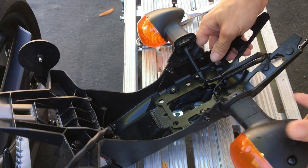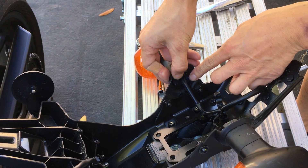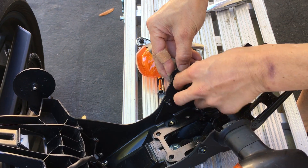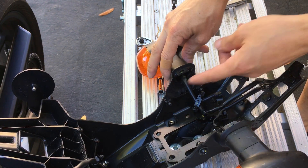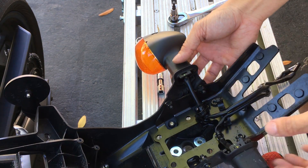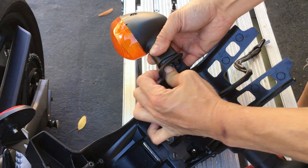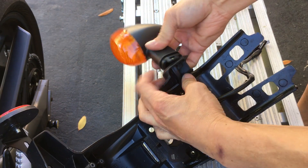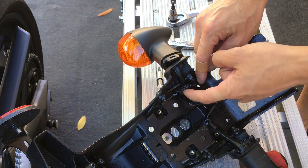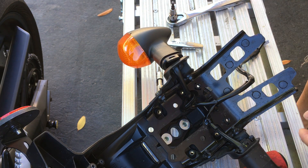Let's look back here. So this is a rubber thing that's holding in some clips. Move those rubber things off and this piece comes off. Once that comes off, basically this whole thing is rubber here, so your turn signal could actually just pop off — like so. But they're being held on by these wire ties here. I can't get to them from this side, so I have to basically unbolt these allen heads here to get to them.